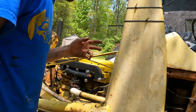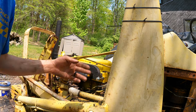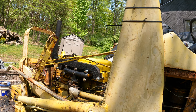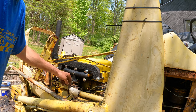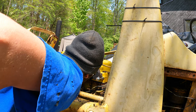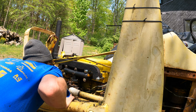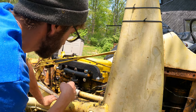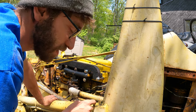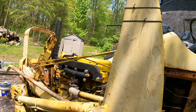Okay, so proper wiring, probably proper fuel. How much did we do on that? Yeah, we burned. It's running off the bottle, and we're not doing any ether. I don't know if you saw, I was playing with this, I adjusted this idle screw all the way in, and the governor still wanted to hold that thing at full speed, so I'm wondering if it just needs adjusted. Bring it all the way down. I don't want to play with the timing anymore, because I feel like I'm pretty close, so I might lock that in. All right, cooling system, rad hoses, steering.